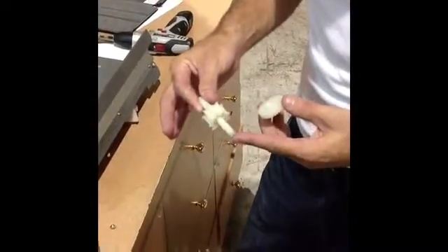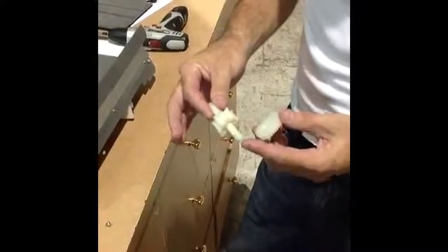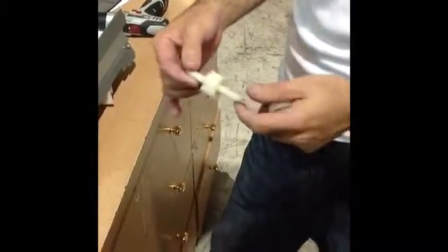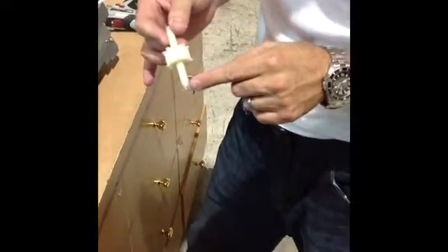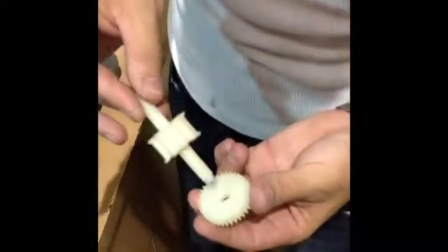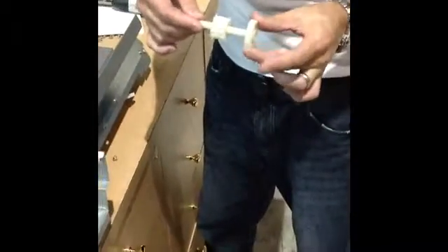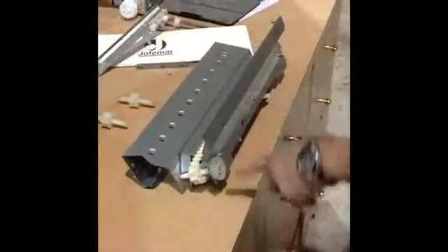The gears received with your parts order — you'll notice you received two of them, and they both look identical. They both have two notches on one side. It's very important that the rear gear's notch goes on the cogwheel that attaches to the motor correctly. It only goes in one way, and use the screw that was supplied with your order. We're going to start off with the rear gear.